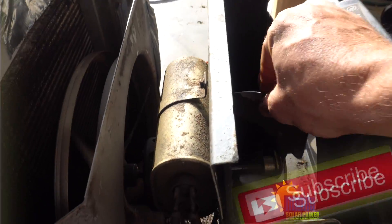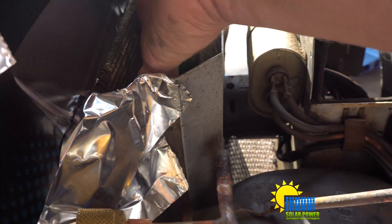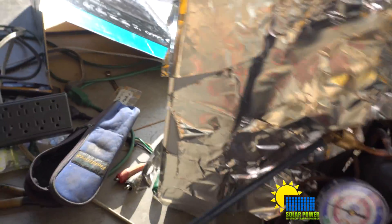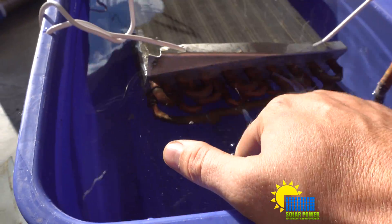This fan doesn't work — it's a window unit and the fan doesn't work right here. So I had to put a box fan on it and tape up the gaps, that way it draws air through this coil right here, which is our condenser coil. It's blowing heat out the other side and removing heat out of this bucket of fluid.